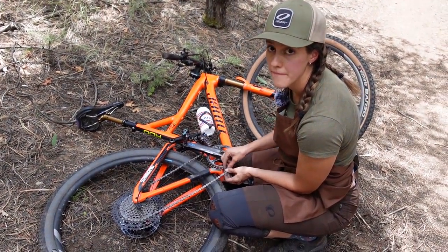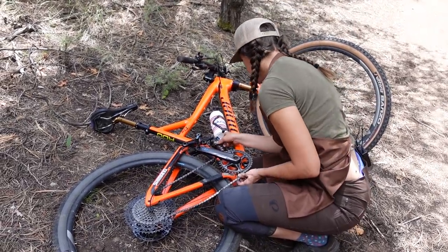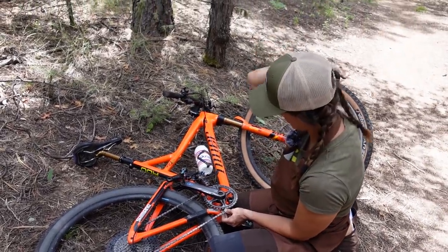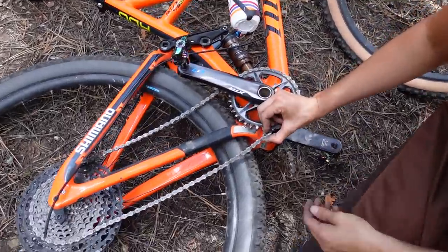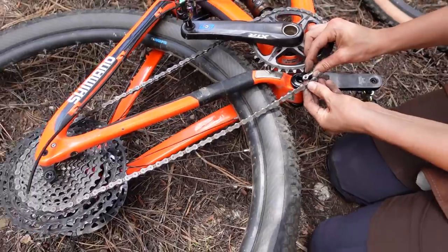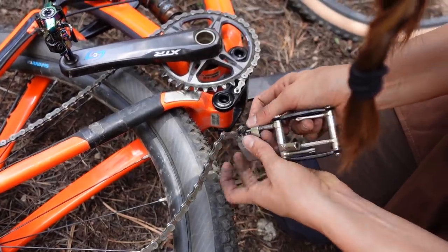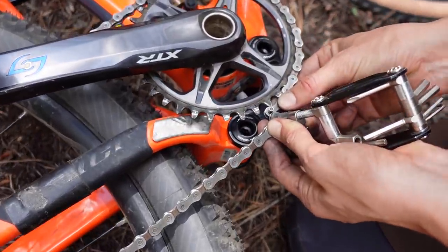A little slack is better, especially on a full suspension bike, because that chain line is getting longer. On a full suspension you're going to put your shock into lockout mode or the firmest mode you can — that's how you're riding — and you're going to be really careful not to compress it. This worked out fairly well in that this is an inner link, so I can pop this pin out and connect these guys like that. Do not let go, because it turns out they all look the same. I'm going to put this in here and confirm one more time that that is the one I want.